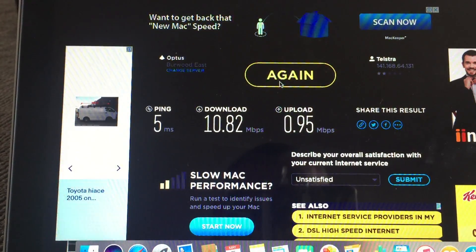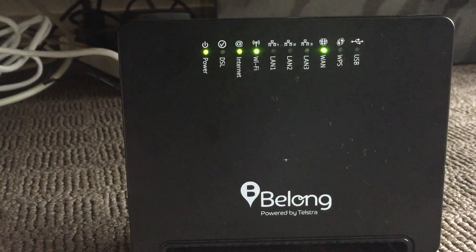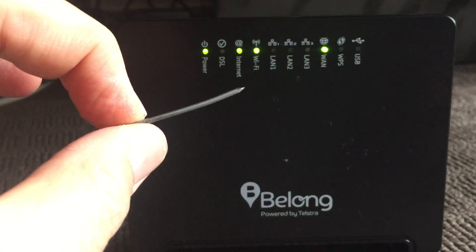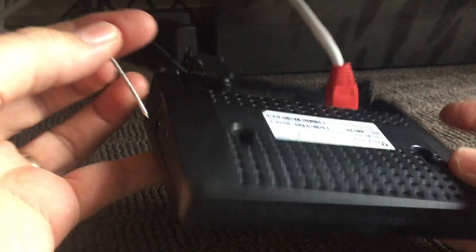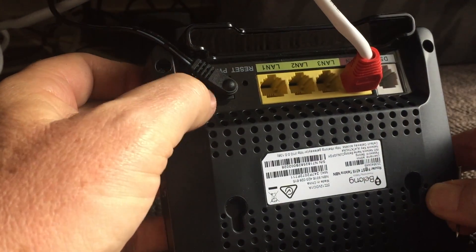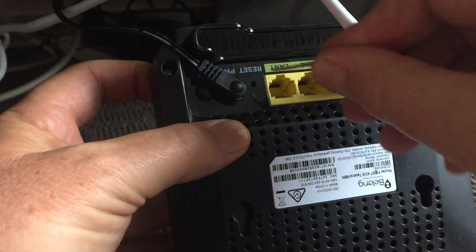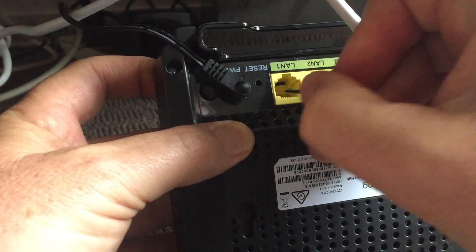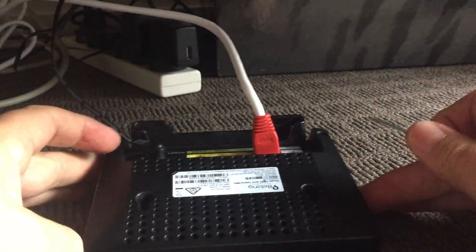You have to call the ISP to get them to do a reset, but what I'm going to talk about in this video is what you can do at home yourself. Resetting the modem is not just pressing the on/off button — it's a little bit more than that. You'll need something small and sharp, like a nail. Turn your modem around, flip it upside down, and there's a little reset button. Poke the nail in, give it a press, and that'll reset the modem — taking everything back to a fresh start.